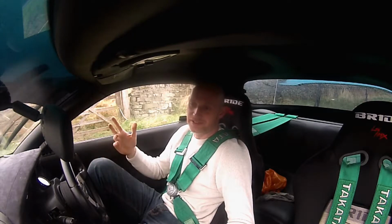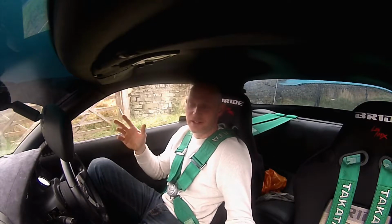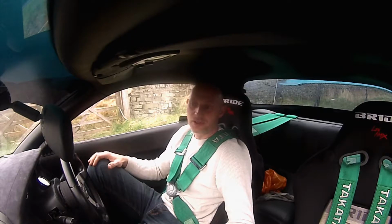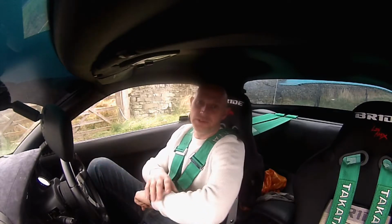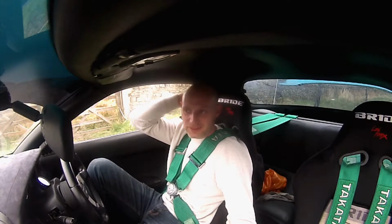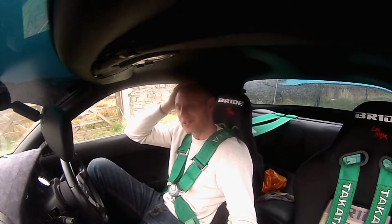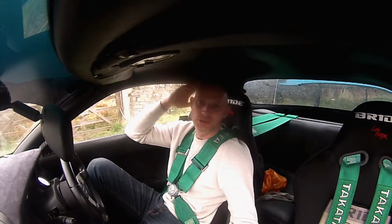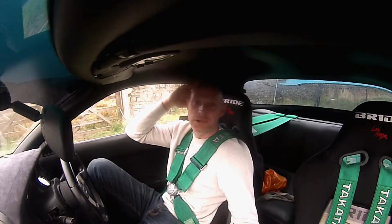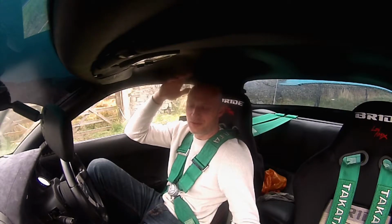So right now, for instance, I've just done a service a week ago. The underneath of the car is a shit tip. I've got an oil leak on my oil filter pedestal, on one of the lines that comes off there for the oil coolers. That's been there since the rebuild, and it's just been one of them jobs that I've never got round to doing. It's in such an awkward spot. It's such a huge nut. It's 24 mil, and it's two copper crush washers. It's like the easiest job in the world. There should be no excuse for it.